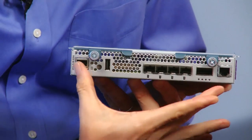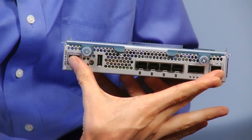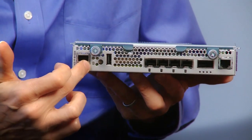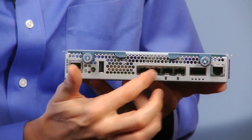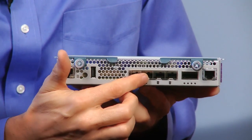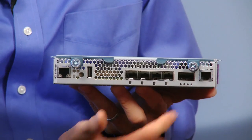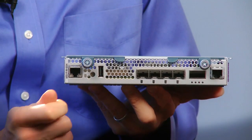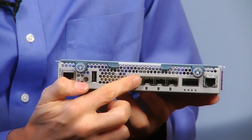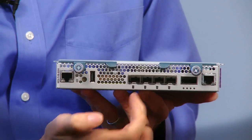Is that what these connectors are for? The storage blade goes into the chassis, but for rack mount servers, yes — these connectors allow us to connect up to rack-based servers. On either side you can see: this is a fabric interconnect, so we have Ethernet management and serial management. We also have four SFP+ ports that allow us to connect at 1 gigabit, 10 gigabit, and Fiber Channel. We also have a QSFP+ port that breaks out to another four 10 gigabit connections — giving us the maximum of 15 servers: 8 blades, one SFP+ reserved for uplink, then 3 rack mount servers plus another 4 rack mount servers connected via QSFP+.